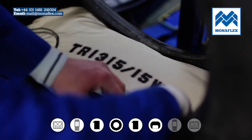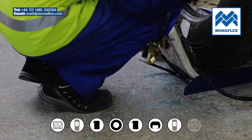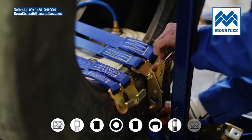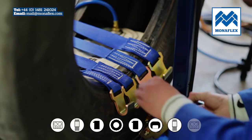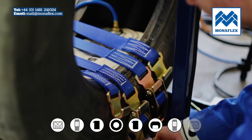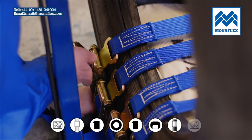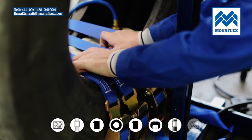The annotated name of the cylinder air bag should be visible on the cover between the beads. Lift the external curing pack up into place on the tyre and pass the hooks through the centre of the tyre. The curing pack and heat pad should be positioned centrally over the repair. With the hooks hanging down on the side wall furthest from the repair, starting from the central strap and working out evenly, bring the buckles up and commence fastening each strap. The straps should be fastened so that buckles are equally spaced and the beads should be pulled together approximately 10% of the relaxed state. Between the beads, check each strap is of a similar tension.